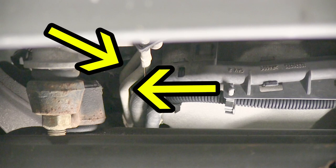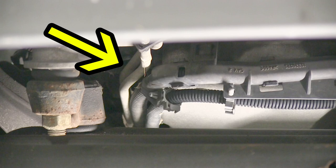We need to locate the vehicle transmission lines. These two lines here run from the radiator cooler to the transmission. The upper line is considered the low side, or the return side, from our transmission cooler back to the transmission. This is the side that we prefer to tap into.